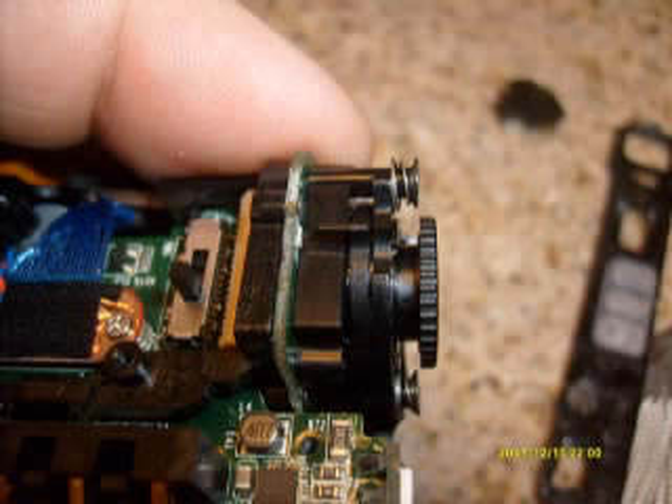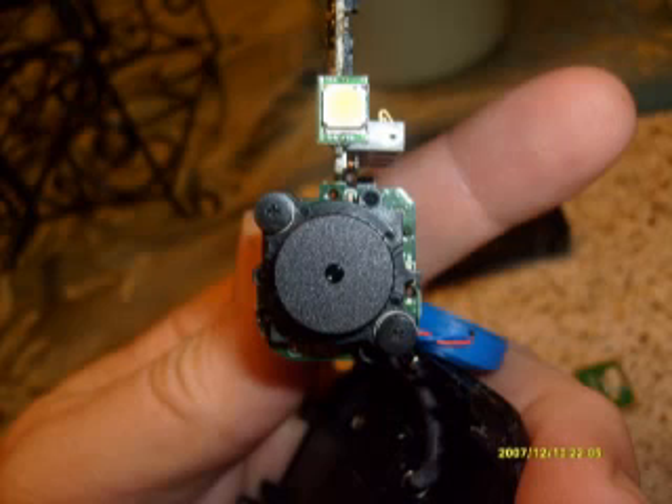The lens is pretty straightforward. It's a macro lens with two spring-adjusted screws that allow it to rotate. All you need to do is pull off the two screws — make sure you don't lose the springs when you do it. Just unscrew these two screws at the front of the sensor, and once you do that, the floating barrel assembly which contains the lens will pop out.